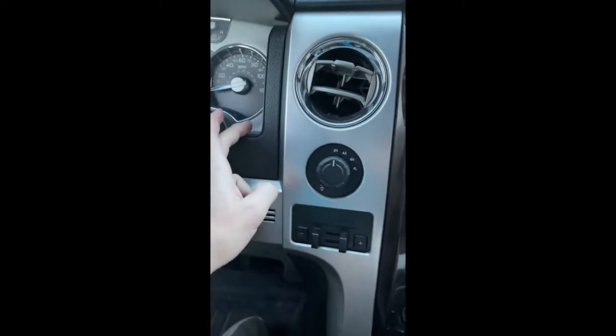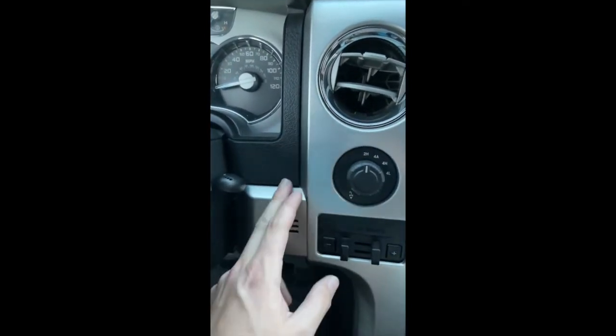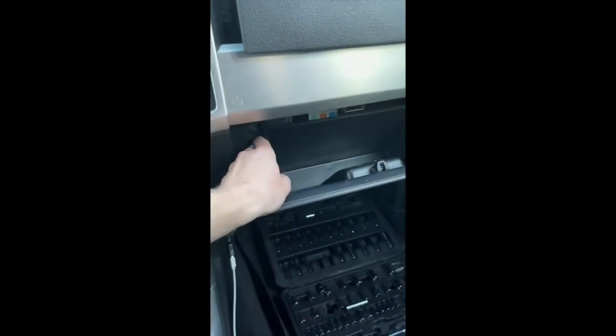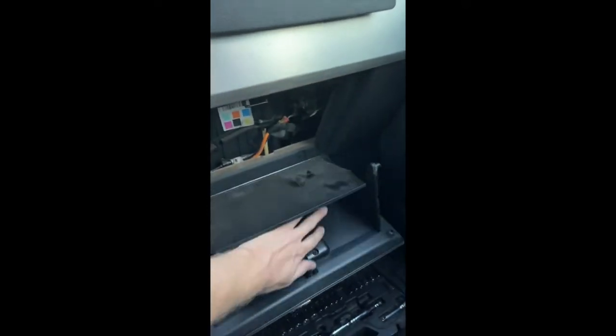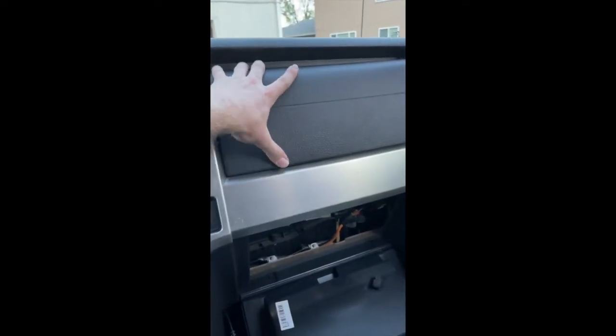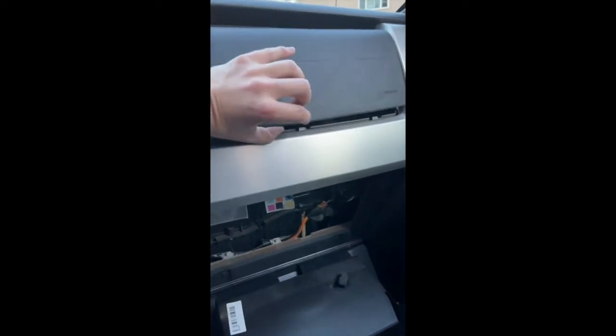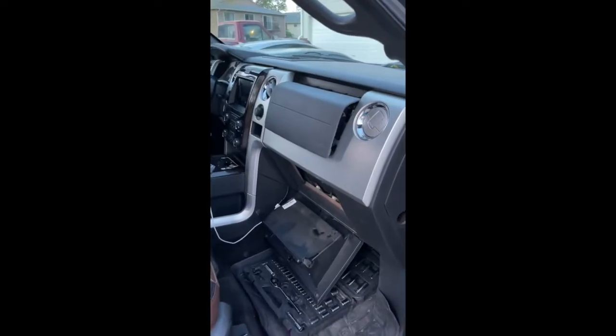This piece was just popping into place — you kind of have to pull up on this plastic piece. Route the cable down here and pop that back in. Now over here, pull this back out — pull that tab on that side and that tab on that side. Then do the three eight-millimeter bolts for the airbag. Before putting the airbag in, there are two gold screws to put in once it's already snapped back into place.